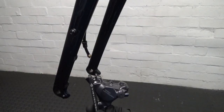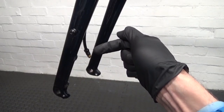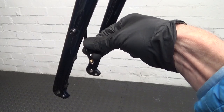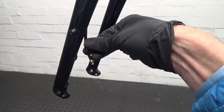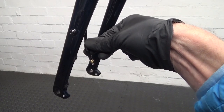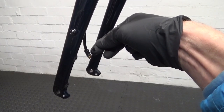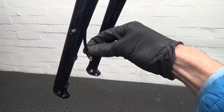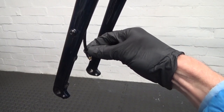Before we go ahead and fit the new caliper on the bike, what you should be doing is changing the olive there, especially if you don't know and you've never changed it before. This one has only just been changed not long ago so it's not fully crushed down. When you do up the nut, as it's threading, it's crushing that olive down. So if yours has been fully tightened up, what will happen — I'll just show you on this one — you can see this one has been fully crushed right down.